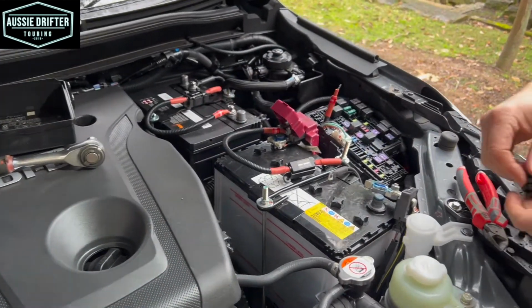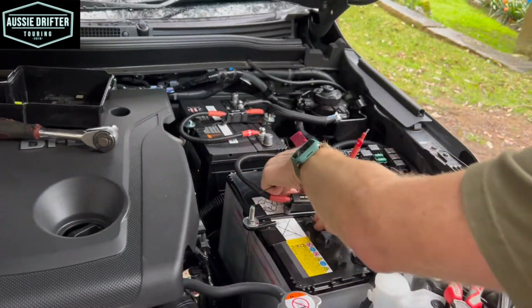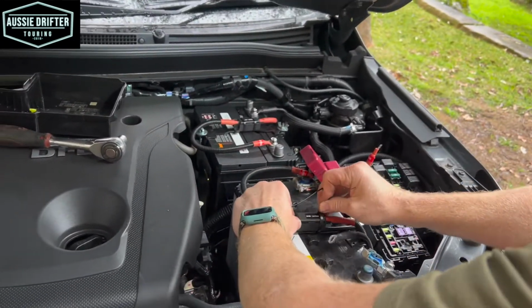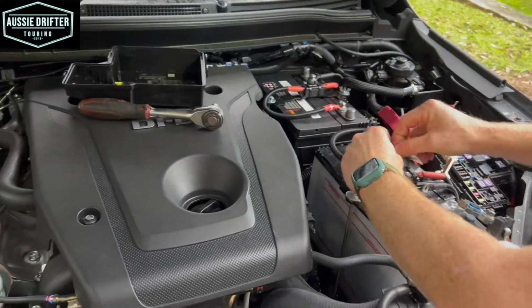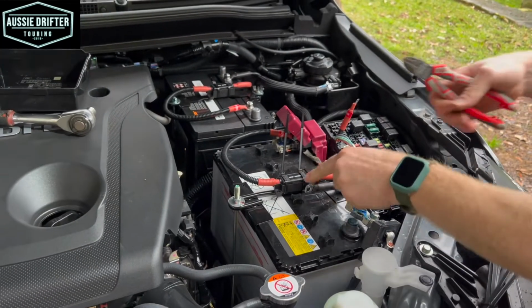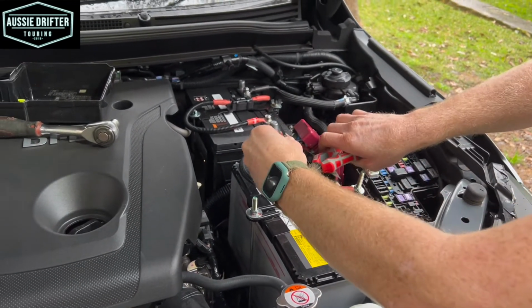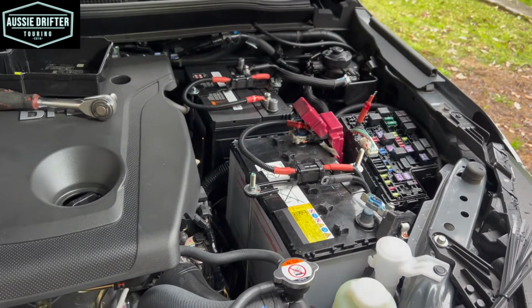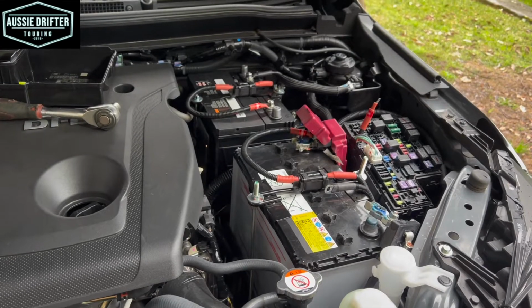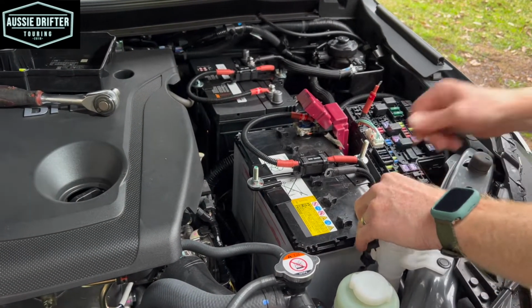Using a couple more of the cable ties in the kit, we can secure our fuse holder to our hold down clamp. And you'll notice that one's marked, so that's how we know. The harness is obviously laid in the position of the batteries, but it's also labelled REDARC main, REDARC auxiliary battery there. So now that we've mounted that and secured it, we can reinstall our negative terminal.